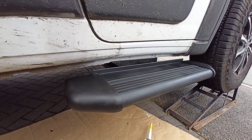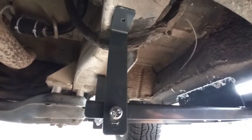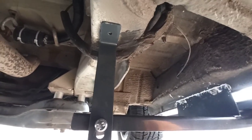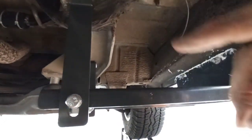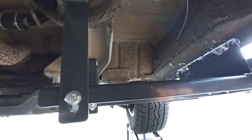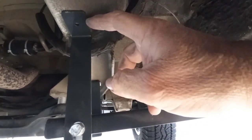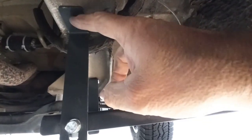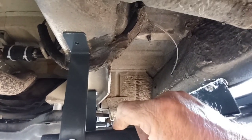Now I'm going to attach the brackets underneath. That's how the brackets bolt on — they screw into the chassis rail. You don't really need anything substantial to bolt them in place, just some tech screws, because when you actually step on the step it's like a seesaw effect — it's actually pushing onto the chassis. I've marked where the hole needs to be drilled, I'll put a pilot hole through first, and then put some PU adhesive to bond it all in place. That'll stop any water or moisture getting inside the chassis.